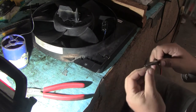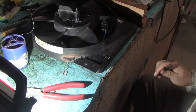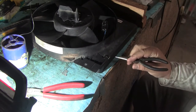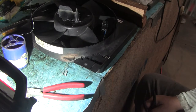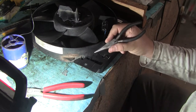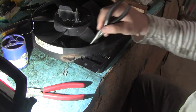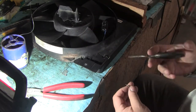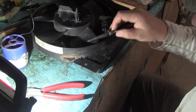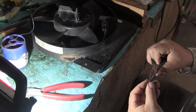Okay, so make sure you tack it on the outside and on the inside. Double tack it, because as you're pushing on this, you put a little stress on it. I had a bunch of the tacks break already once. So these tacks are like an eighth inch in diameter. It's not a big deal. You just want to blend the plastic in multiple places, and that's what gives it strength, until you finish repairing it. Now the good thing is when this cracked again, this held up perfectly and it was really stiff and strong. It's pretty neat.